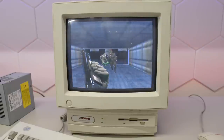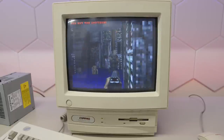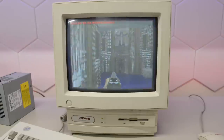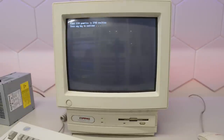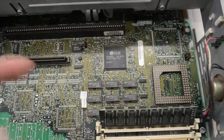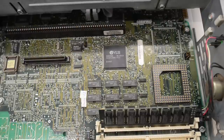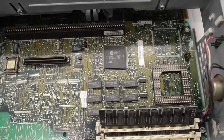It's still slow — what's up with this? I didn't expect too much, but this is way slower than I expected. We've got 3740 real ticks, giving us 19.97 fps. So is this the fastest this machine will go? I guess perhaps the graphics is our issue here. By the way, I think I forgot to mention — this board has a Cirrus Logic 5420 and it runs off the ISA bus. So that's why I didn't expect much, but I did expect more than this.